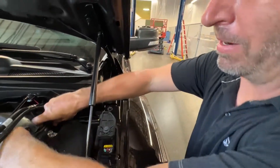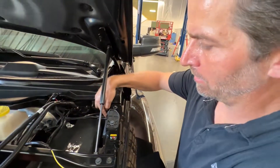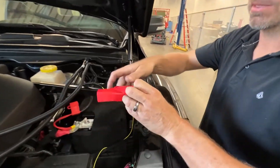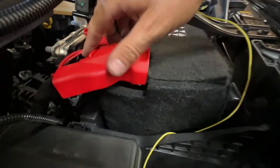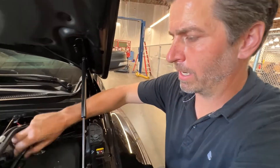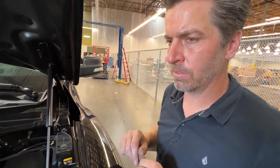Connecting the power and ground: pulled the fuses out, connected chassis ground, positive terminal on the battery. Obviously the cover goes back on once we're done. We'll wait to tie this up once everything is all tied in place.